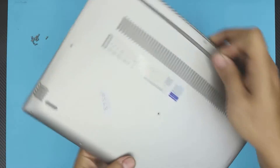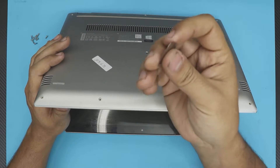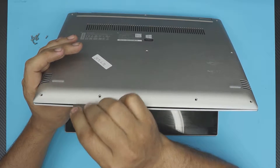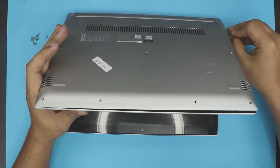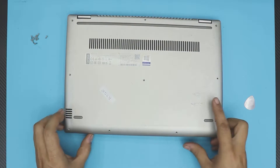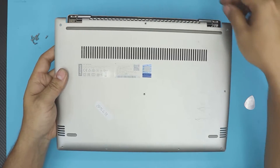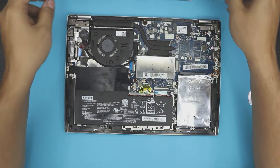Once you have the screws removed, open your laptop at a 45-degree angle. Then grab your opening tool from the set, or just grab any guitar pick. Slide it in between the top and the bottom cover and wiggle it around — you're going to hear some clicks. Do the same on the other side, and once you see it come loose a little bit, close it and grab the cover on top and wiggle it around. It should come up. You might have to work around the back side with your opening tool, twisting it a bit. Sometimes it comes easy, sometimes it needs a little more wiggling.